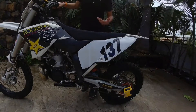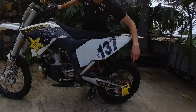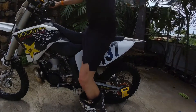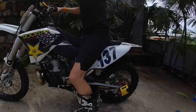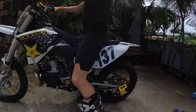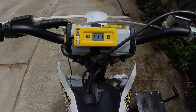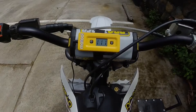Now we're seeing what's called the static sag — you can see it's 29 millimeters. We're going to set the rider sag, so sit in a neutral position, compress the suspension, and try not to touch the ground so you can get your sag readout. You can see my sag is right about 111 millimeters — that is way too much sag, especially for the tight, cornery track that I ride.